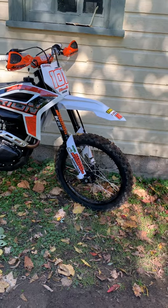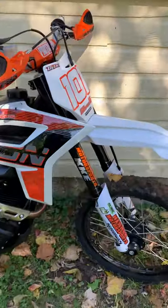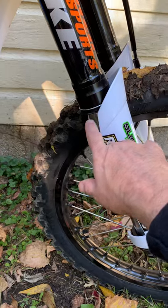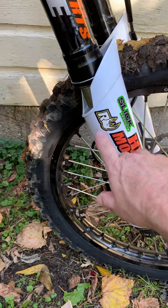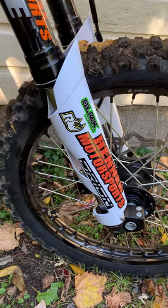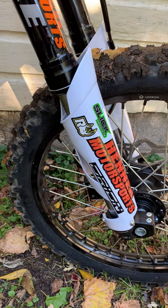The biggest thing I want to talk about is my custom preload spacers. Everyone that's already got theirs posts pictures or videos of them sitting on the ground on the kickstand. But just on the bike's own weight, if you look at your fork where it sits relative to the fork guard, a lot of these bikes are sitting with that section of fork way down — you're losing like three inches of travel just on sag, because the bike sits front-down since the back is high.